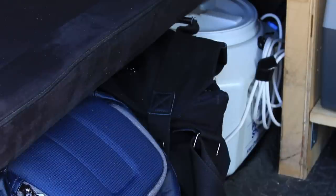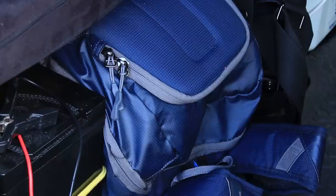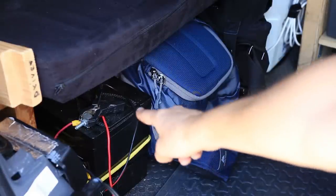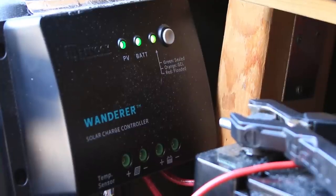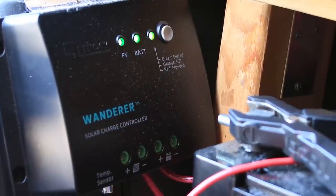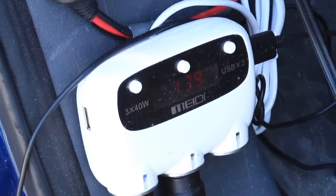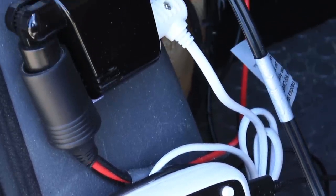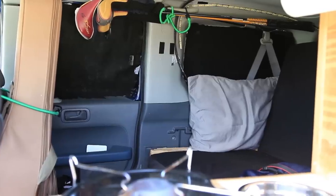I use the area underneath the bed for storage — my laptop bag on the right and a 35-liter backpack where I now fit all of my clothes after downsizing from an old suitcase. Next to the backpack is my 100 amp-hour AGM battery, which is the core of my solar system. It keeps my fridge running 24/7 and charges electronics and runs my electric fan at night. Next to it is the Renogy Wanderer charge controller, which works great with the rigid solar panel on the roof. The entire system is 12-volt — I'm still not running an inverter — and I have special adapters to charge my laptop, drone battery, and camera batteries.